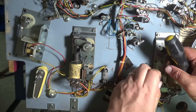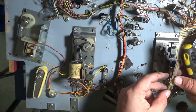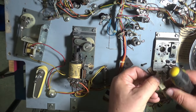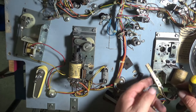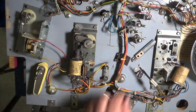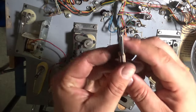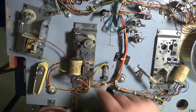The only soldering I'm going to need to do here is on the leaf switch. There are some spacers here, but I don't know — they seem to be attached to the leaf switch itself. The one on the other side doesn't have these spacers, so this is just an old style one. Now let me get the new leaf switch on. I had a look at the pictures and you'll see there is a long side and a short side of the switches — the short side goes closest to the coil stop.